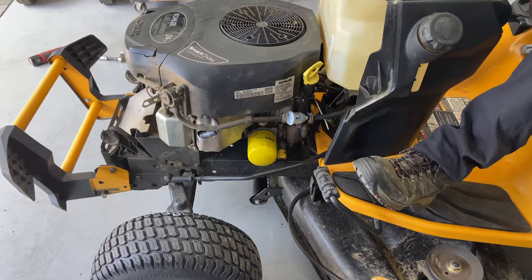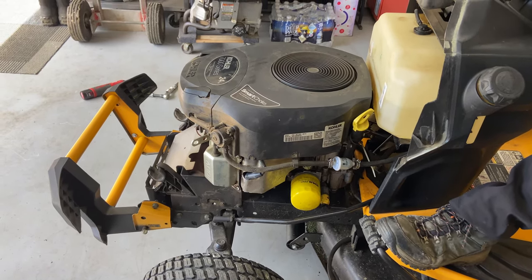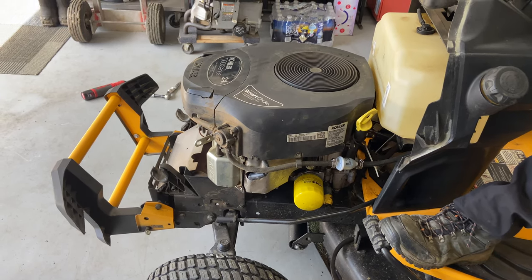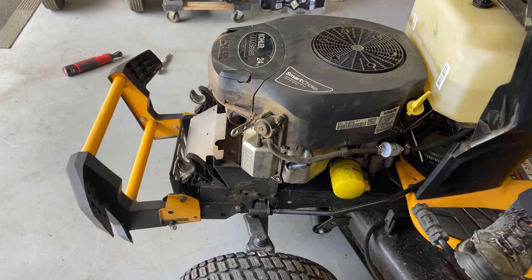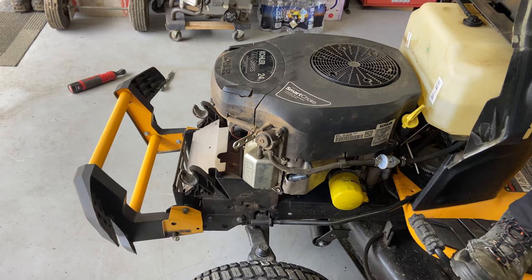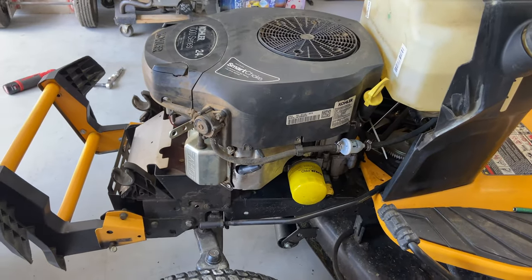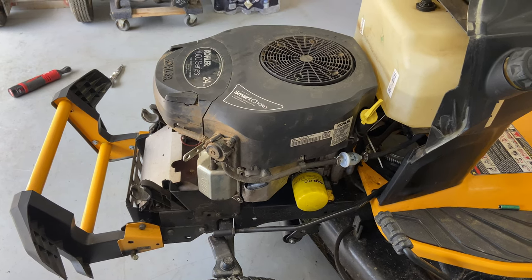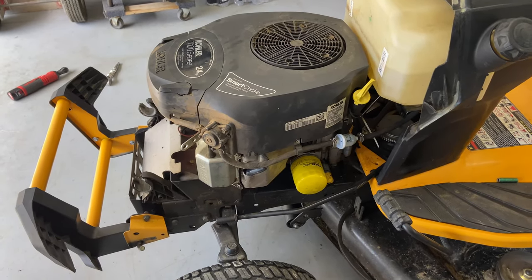Let's go ahead and give her a shot — fire it up and see what it sounds like. Well, there you go — it sounds much better. There's a little popping and missing on the top end, and that's probably from all the fuel that accumulated and wasn't fired and burned — it may take a little bit to clear out. That pretty much sums it up for how to install and diagnose an ignition coil going bad on a Kohler 7000 series engine. This will go for pretty much all the twin-cylinder 7000 series engines as far as diagnosing goes. Luckily it was just an ignition coil and not internal. If you guys like this video, please give it a thumbs up, subscribe, tell your friends about my channel, and I'll catch you guys on the next one.